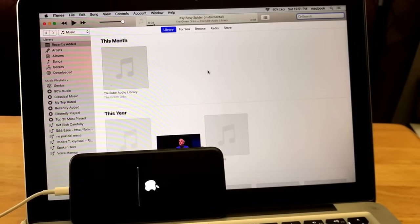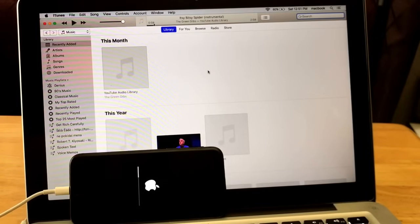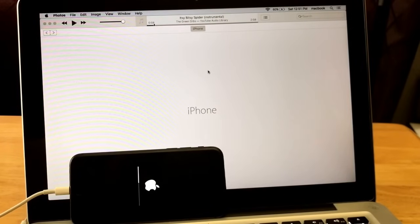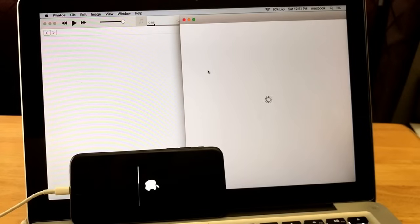It's getting back to its original settings and you're going to get to the Hello screen. If you're doing a hard reset to clear it to sell it, I strongly recommend going through the startup wizard — but when it asks for your iCloud information, don't put that in. If it's asking for any kind of personal information, don't do anything. I usually don't set up Siri, don't set anything up, and don't add any kind of passcode. Leave everything clear, and when you get to the home screen, check that the device is clear and your iCloud is signed out.